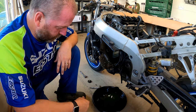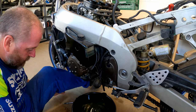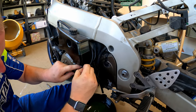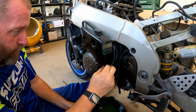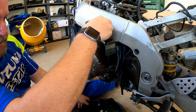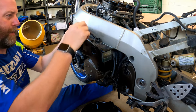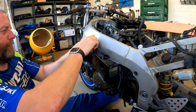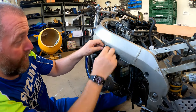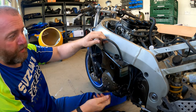I think we're pretty much there now. The next thing we're going to do is take the bottom hose off the expansion reservoir and obviously drain that out as well. That's really odd - I wouldn't have expected that. It could be that there's a vapor lock inside. You would think taking the lid off would help, but it could be that it's completely gummed up with rubbish.